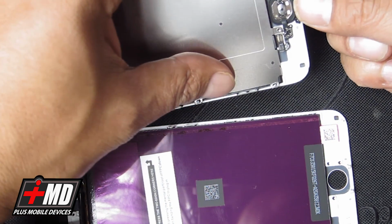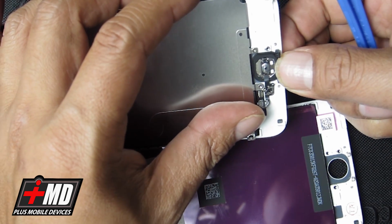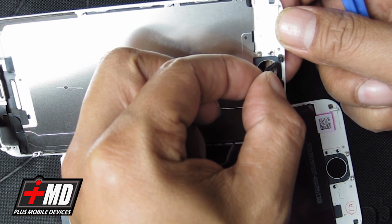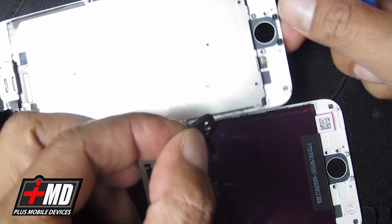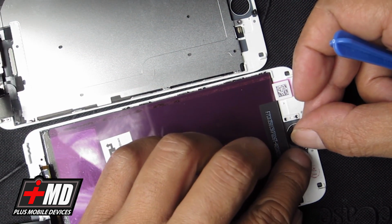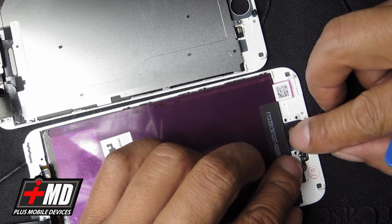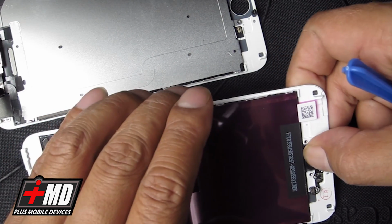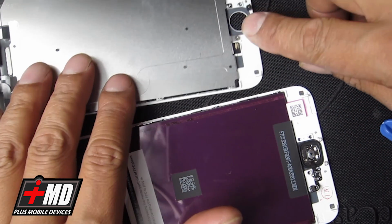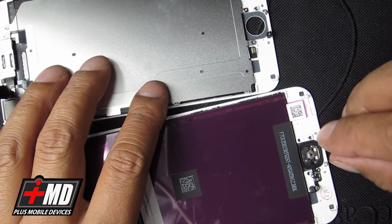like we have here. Now go ahead and lightly push. Okay, you have this gasket here that's rubberized. The heat will actually loosen the rubberized adhesive of the gasket. Alright, so carefully transfer it over. And now once we have that, go ahead and transfer it onto this slot here. There are a few dimples here for you to place it for spacing. Okay, now we have that transferred over. Home button is good. So now you also notice there are these rubberized bumpers. We'll go ahead and transfer those over also.